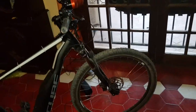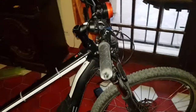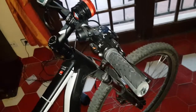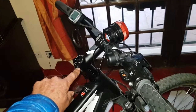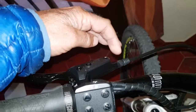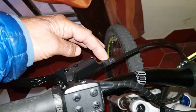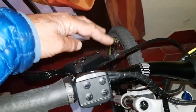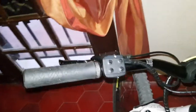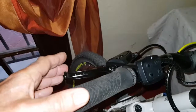What else did I do on this? It was just sort of juddering a bit, and I just needed those two screws loosening off and that tightening up. And this one — as soon as I got it out of the box, it squirted out hydraulic fluid from here. Then it seemed to settle itself and worked for days, then it came out again and I lost brakes altogether.